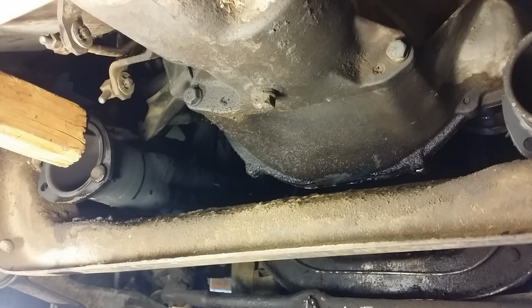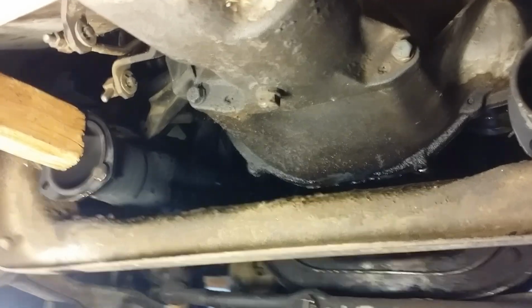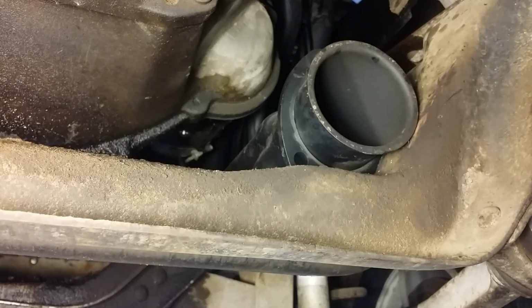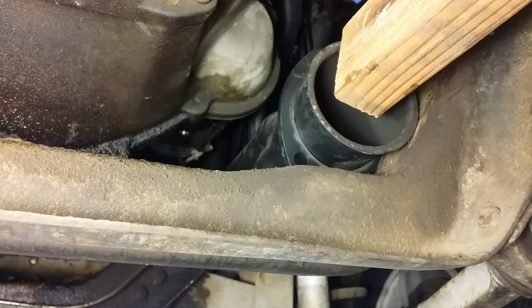So this isn't going to be just a plug and play situation, because we don't want this thing to rattle, so we need to come up an inch and a half or so. But the header itself is in a good spot, and it's cleared the clutch linkage and everything. Now, on the passenger side, Houston, we have a problem. We're already hitting the cross member. There's not even room for the 3-bolt flange, and we still have that same height issue.